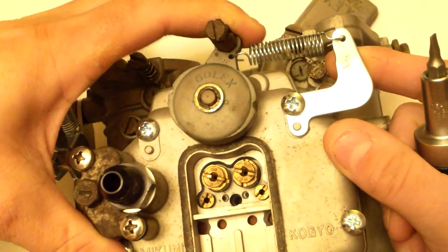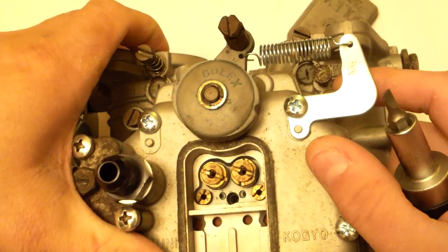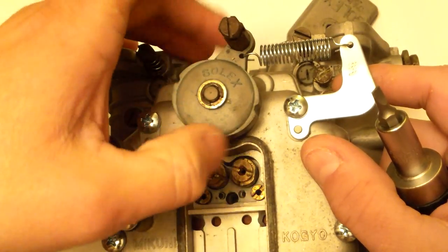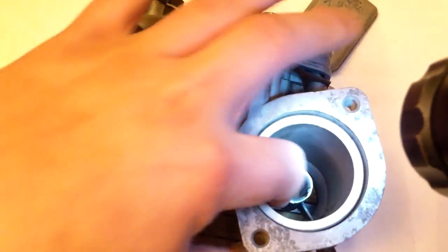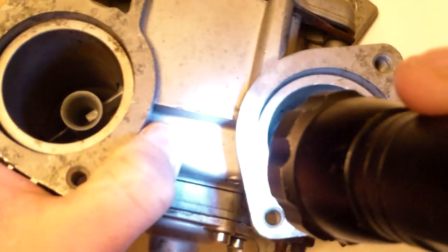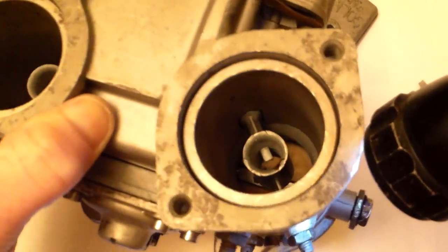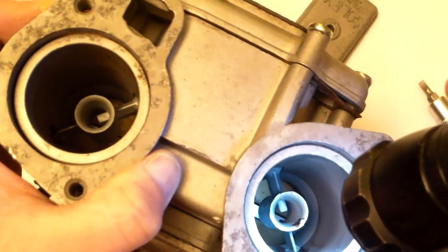This is your starter, also known as a choke. I've seen people online use these and I've seen people not use them — I'm going to make a determination after I start the car. Down there you'll see a little number 32; that is the size of the chokes on this. They're called chokes because they actually choke the air. For a 40mm you can go as big as a 36mm choke. For drivability and some racing you can do 32mm, so I'm just going to stick with the 32mm I have here. If you go to a 36mm choke in a 40mm, you might as well just go to the 44s in my opinion.